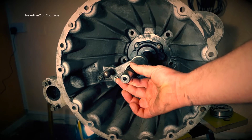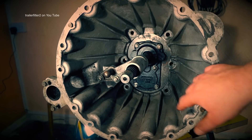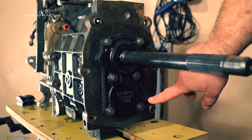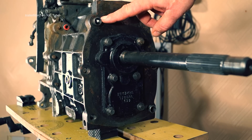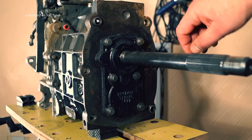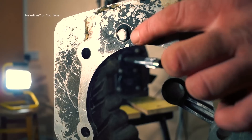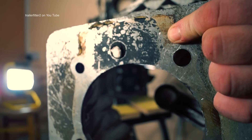This is the input shaft and the splines are where your clutch is. At the back there's a seal. The bell housing is held on by six bolts and you also have dowel pegs, which are really important to add strength and to locate the bell housing properly. There's also a core plug just up here, which can leak — it looks like the last person who fitted this used some RTV to stop it from leaking.